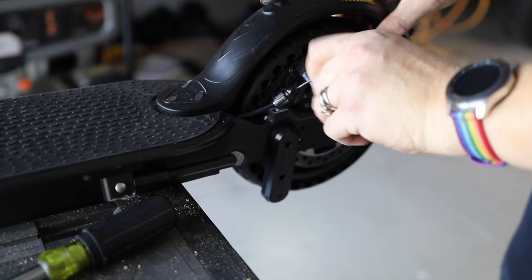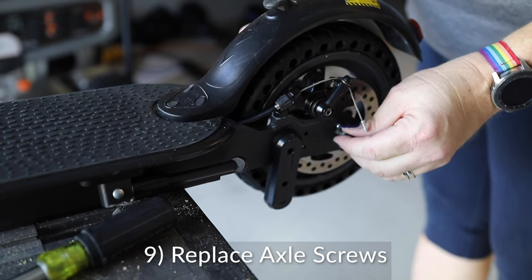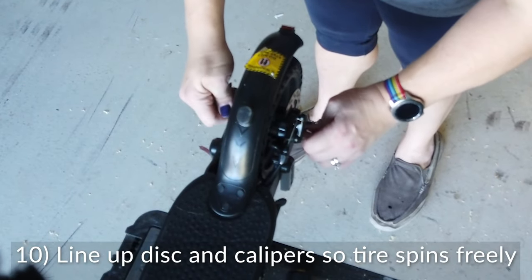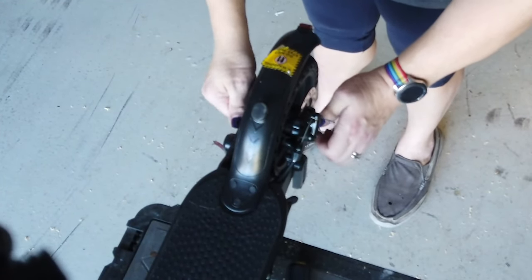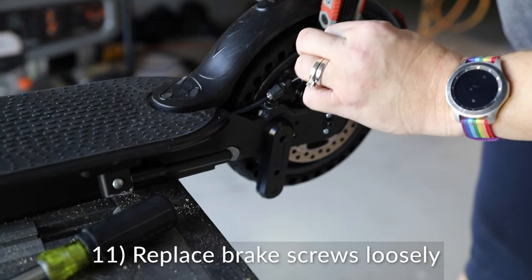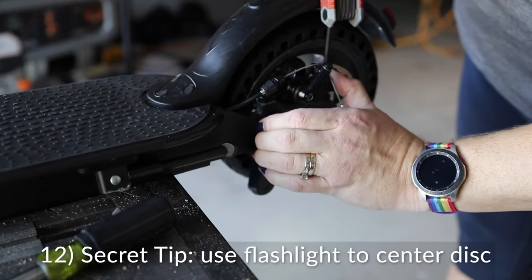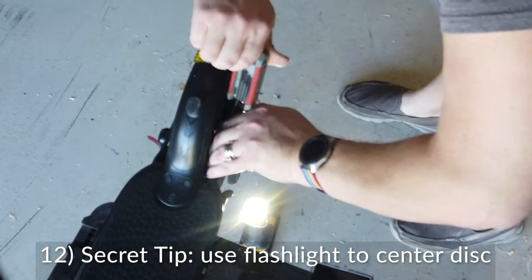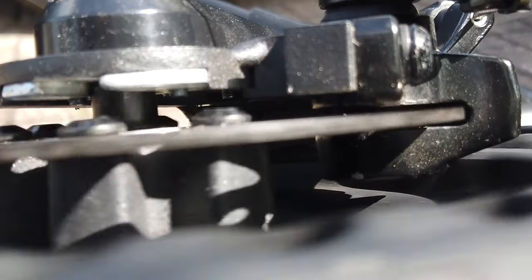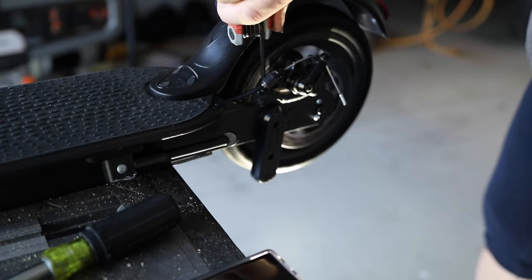I have another video that covers parts of this, so I'm not going into deep detail, but I do want to note that the brake must be realigned and the wheel must be able to spin freely with the brake caliper around the disc — otherwise you'll have premature rubbing on your brake pads and disc. My secret to get this lined up correctly is to take a flashlight, put it on the ground, and shine it up centered into the disc and brakes. That way, standing behind it, you can watch the tire rotate and make adjustments where the disc rubs the brake pads.